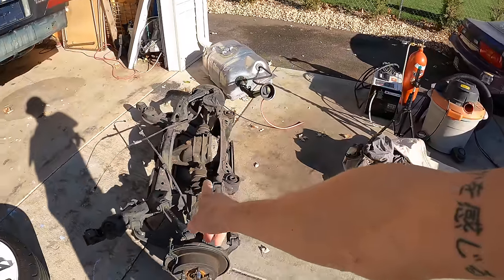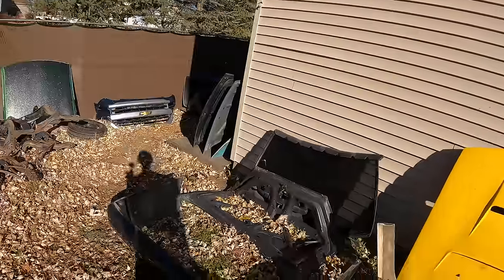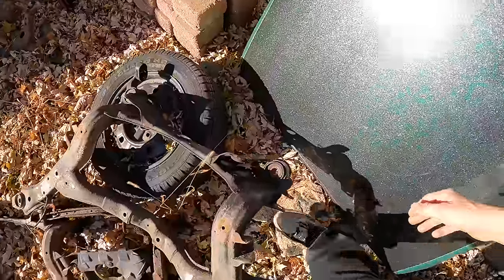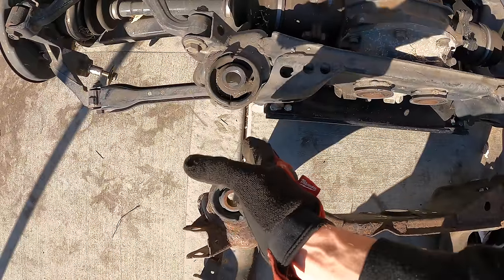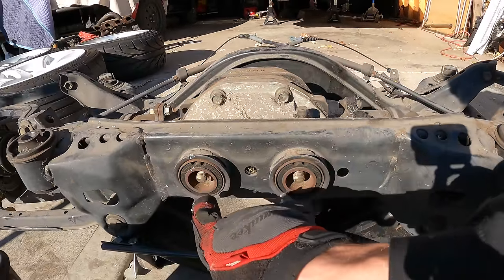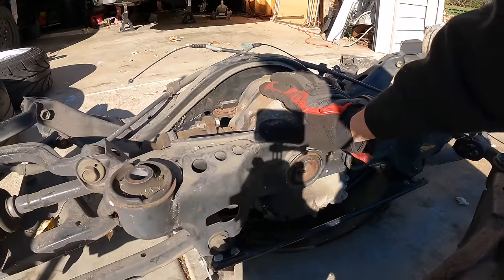Before I throw in the Y32 Gloria subframe, I wanted to see if an S13 subframe will fit this car. That could be some beneficial knowledge for whatever this project holds in the future. You can tell this is an S13 subframe because there's no bushings in the back of it — it's just solid mounted. I've butted the S13 to the back end of the Gloria subframe and lined up these two points here. You can see that the Gloria side goes out farther. The Gloria subframe also utilizes the bushings to hold in the diff. They do look pretty similar, but they are quite different. I'm wondering if an S14 subframe is more comparable to the Gloria subframe.